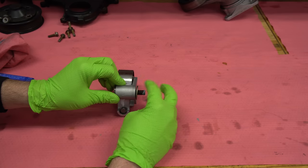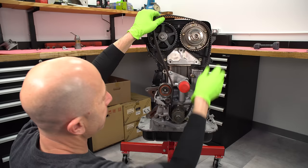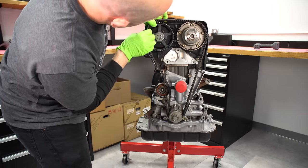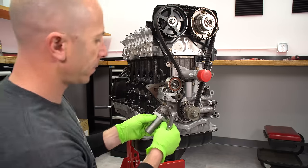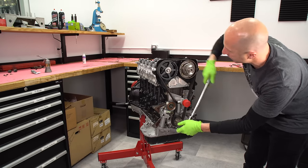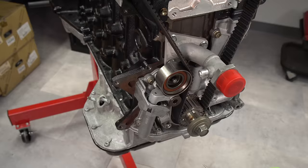A little bit of blue Loctite — we'll install the tensioner pulley, torquing it on, and now we're gonna install the timing belt. The timing belt has a very specific alignment: on the lower gear there's an alignment mark on the gear and also on each one of the cam gears. We'll align each one of those and then put the timing belt on. Last, we're gonna put the timing tensioner in. What it does is put tension on the timing belt — before I pull the pin and put tension on the belt, I'm gonna turn it two revolutions and make sure everything is still lined up properly. Once I know it's all lined up perfect, I'll pull the pin and allow the tensioner to tension the belt, then turn it again and triple check that the belt is aligned properly.